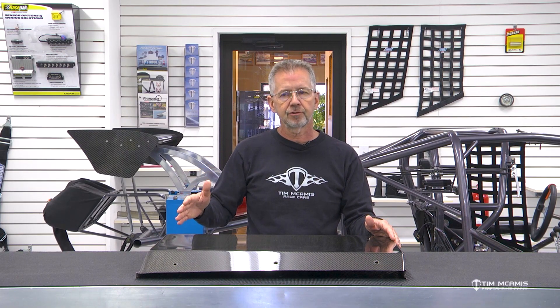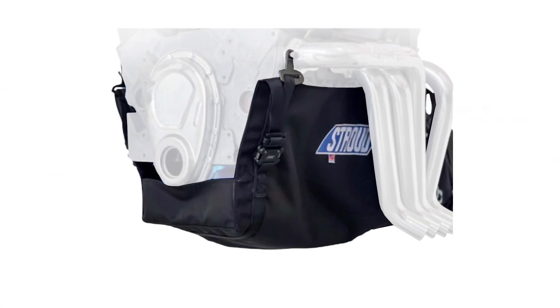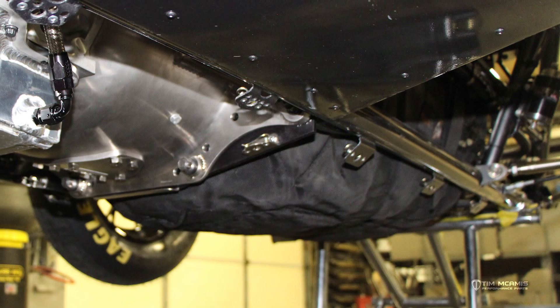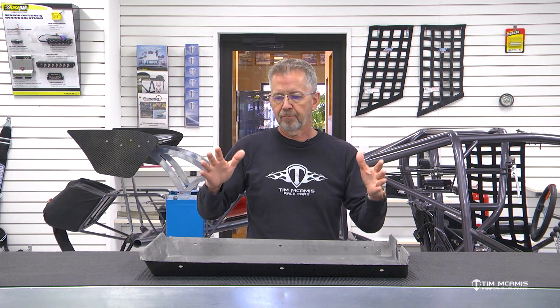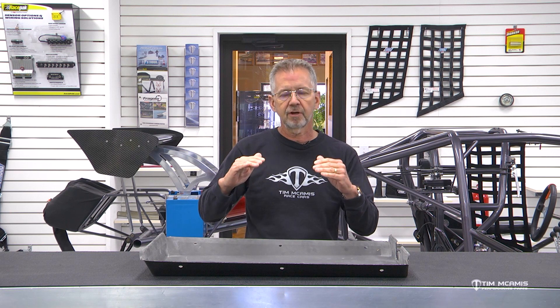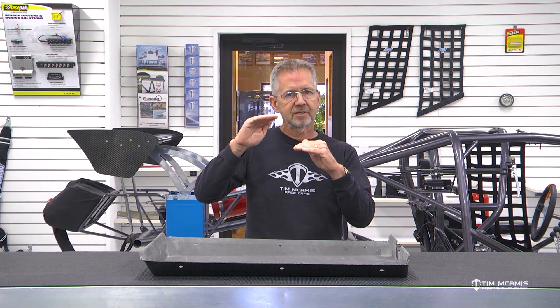It's going to be an additional support device for the engine containment system. So when you put that diaper on the engine, it's going to contain the penetration from the pan and any oil that may come out and any type of connecting rod pieces — because it's basically going to cover the bottom of the engine all the way up to the sides, front, and rear. It's hard to get it to stay up tight, and it's also tough for the wind flow going under the car to keep it from flapping. If you ever watch these cars from the back and get down low, you can see the diaper kind of flapping underneath the car, which is going to mess with the starting line lights and also the finish line lights.